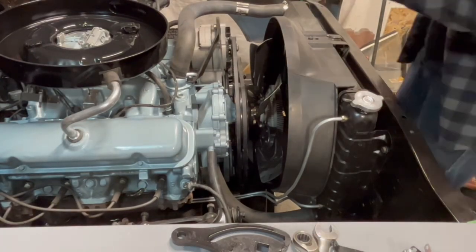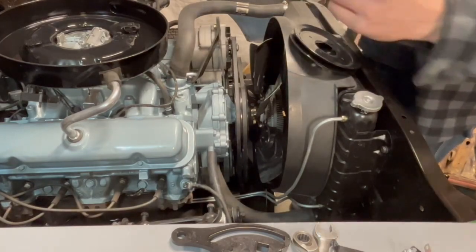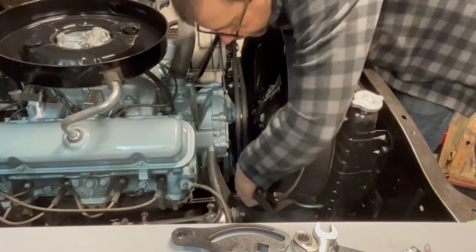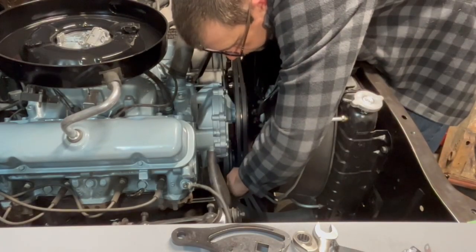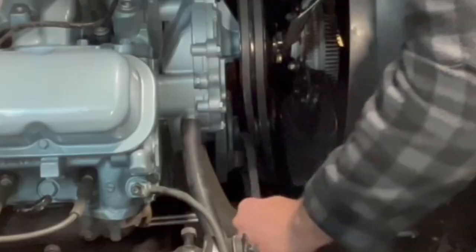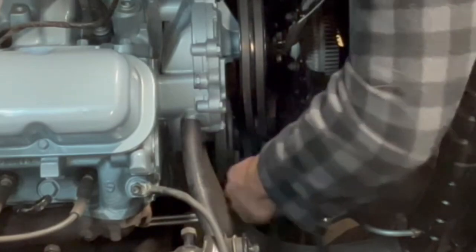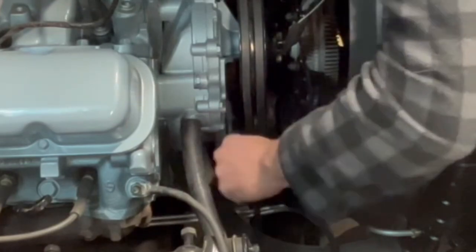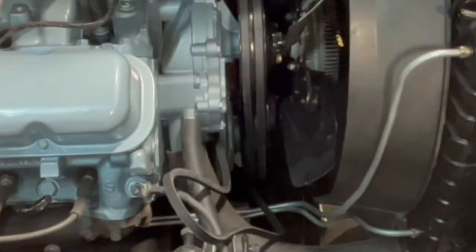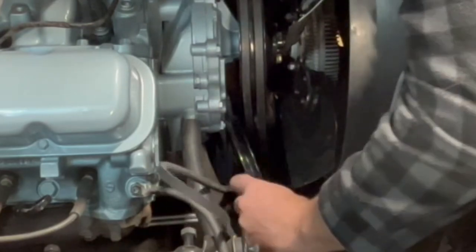My hope is to just sneak that thing off, hook the belt between the two pulleys, and go back together. I'm not sure how this is going to go but we're about to find out. I've pulled the pulley further forward and can slide the AC pulley in behind it. The reason I'm doing it this way is I don't have to remove the other v-belts completely off the car to get this routed. That's in place — now we'll do the same thing with the belt pulley and sneak it down in here.